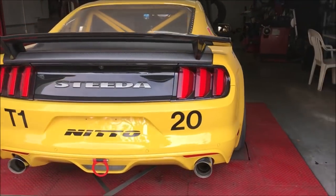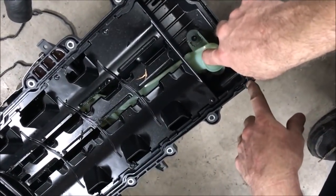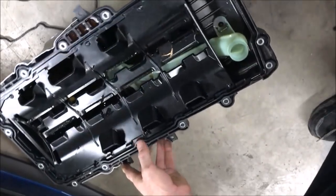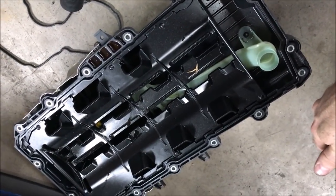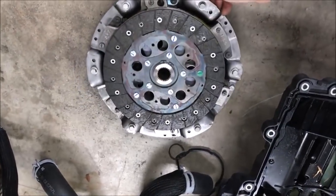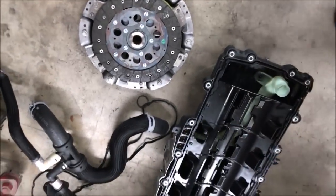Maybe if I'm lucky I'll get to see them put it on the dyno later and fire it up - smell the race gas. On the 2018, they changed the oil pan design. It used to be a metal pickup, but now it's a plastic pickup adhered to a plastic oil pan, and the windage tray is part of the oil pan itself. They started with this style on the GT350, then went to this with the 2018 - probably trying to make it lighter. Also plastic is cheaper. This is the dual clutch setup in an 2018, alongside the MT82. Right here is the MT84, and they went with a dual mass flywheel for the clutch application - very compact, very cool.